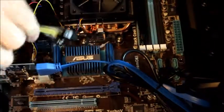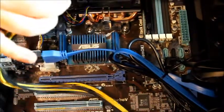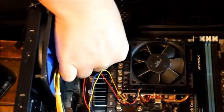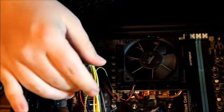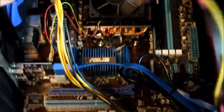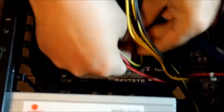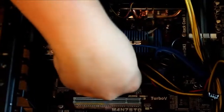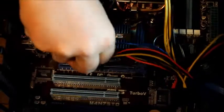Now we're going to install the power. There are several power spots on the motherboard — there are two for the main power. The top one is an 8-pin, so we're going to install the two 4-pin connectors. They just click in and can't really be plugged in the wrong direction because they're shaped to prevent that. Our USB expansion card also needs power, so we're going to insert the Molex connector into its spot. Sometimes the Molex connectors don't like to push in all the way, so you've got to push them kind of hard.